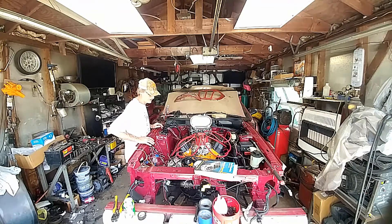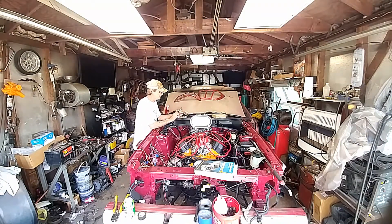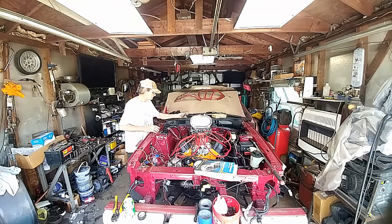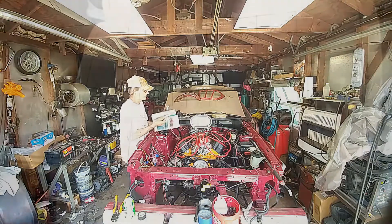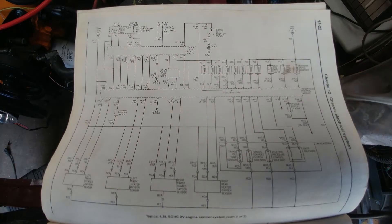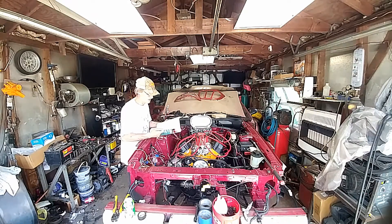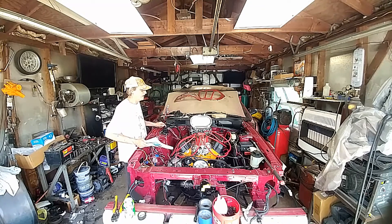What we're doing today is wiring and eliminating wires. Opening up the wire, basically you want to find your little split in the coating — if you're going to save it, otherwise you can buy new. Run a razor blade down it real fine; this is not black tape, it's just a covering — not sticky and you can peel it right off. Then expose your wires. In the back of the book they give you every diagram, wire color coding, and everything for the 4.6 and for the 5.0 — which is 302, 347, 289 — whatever your application, so you'll know what wires are what and where they go.